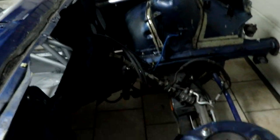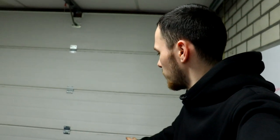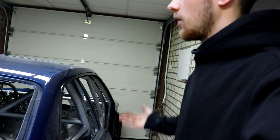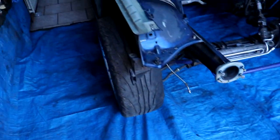The bay is of course not painted - this is just to keep the rust away. Tomorrow we are going to paint the bay with Mark. I've already sanded the bay, just need to tape everything off the complete car and get everything ready for paint. I'm probably going to take the front axle off as well, push the car as far back as possible, jack it up, and remove the front subframe.